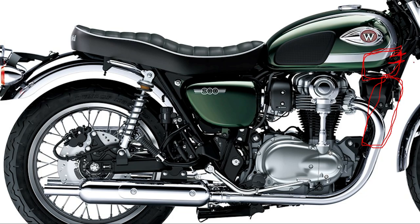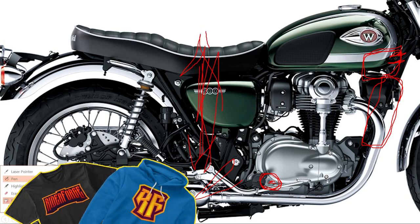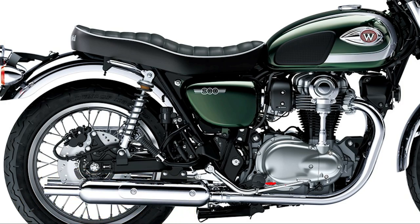The other thing we're going to look at, of course, is that oil level, and that is checked right there. Can you see that little spyglass in there? There's a little glass window, and it's got lines on the side of it — it has a maximum and a minimum oil level. That's really how you want to keep your oil level. The bike needs to be perfectly upright or on the side stand, depending on the model, so this is something you need to check in your owner's manual. People get this wrong all the time. Your owner's manual is going to tell you how to position the motorcycle — should it be leaned over on the side stand or standing straight up and down? If you can see oil in here when the bike is vertical, it's probably fine. But check your manual to make sure you're reading it correctly. That's the most important thing you can do for your bike for maintenance purposes.